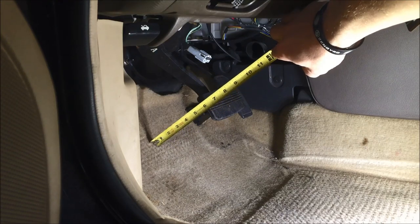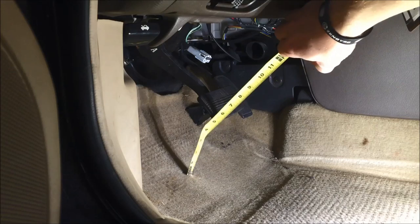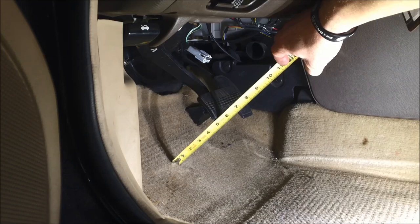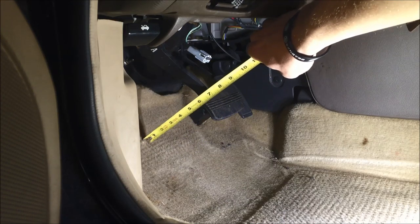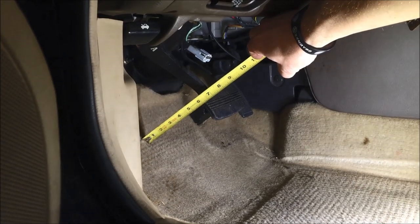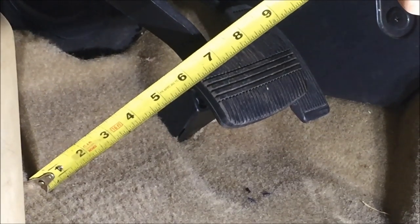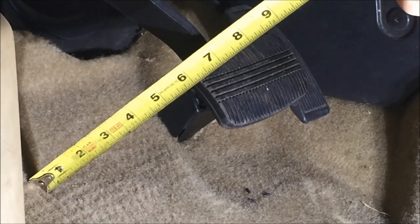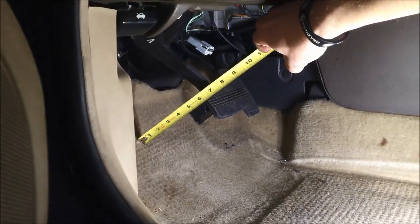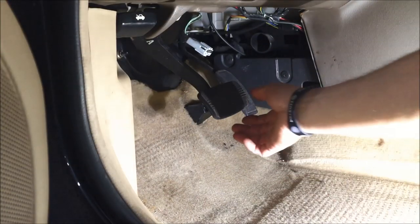The first thing I want to show you is where you're going to measure from. Depending on where your tape measure is, you will get different measurements. This is the incorrect place here — the correct place is directly behind the brake pedal. This height should be measured first before any brake application is done. Compare that to specifications.